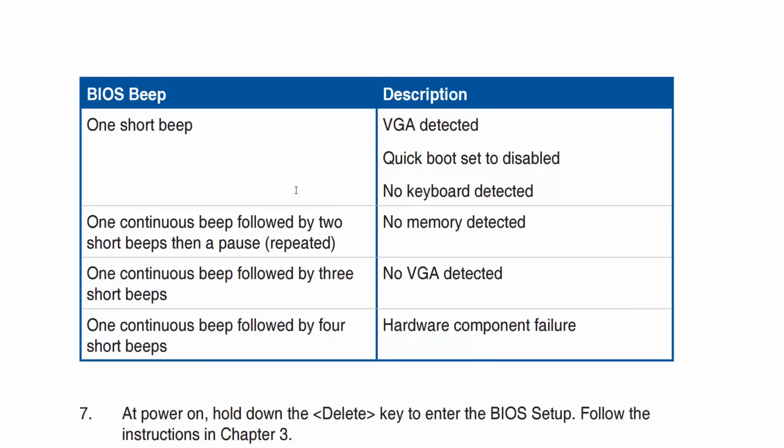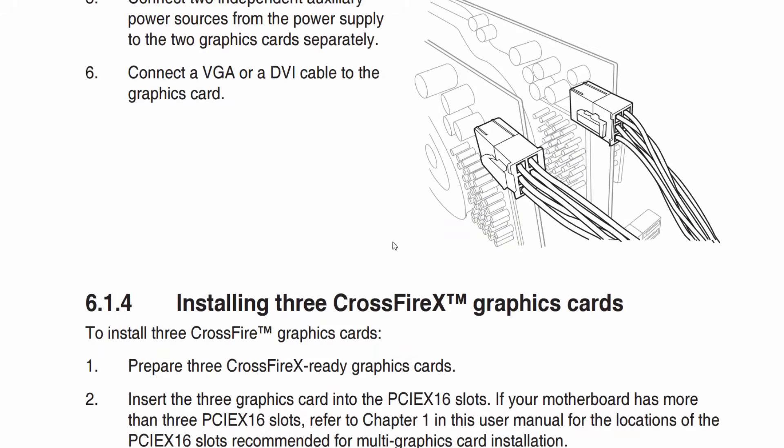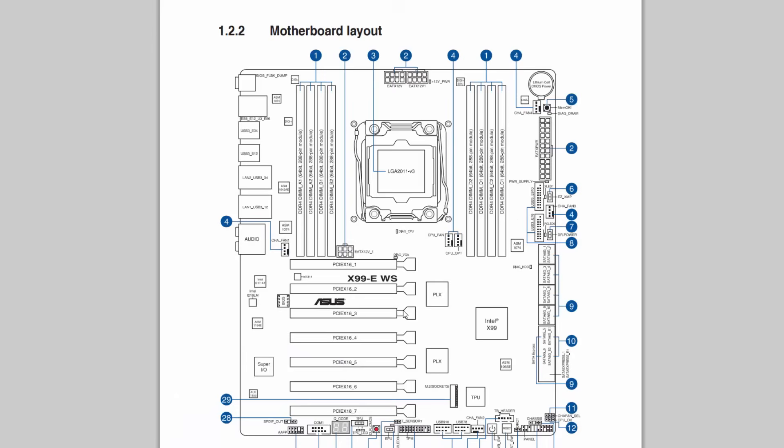These are various beep codes you also need to be aware of for the CompTIA exam. Many graphics cards today require additional power — PCI Express power. We'll get into power supplies later, but here are two graphic cards with additional power from the power supply, called PCI Express connectors.